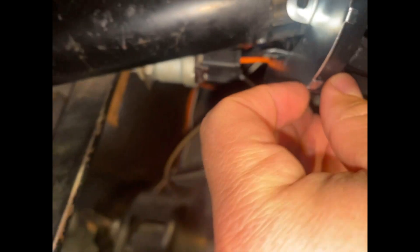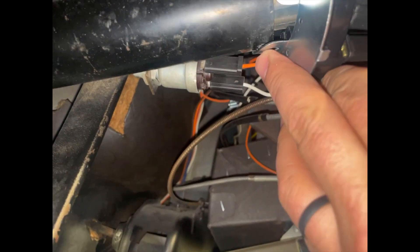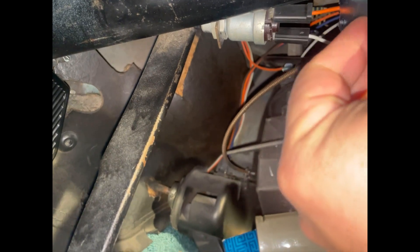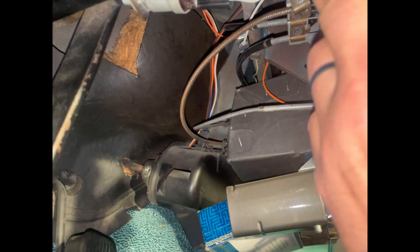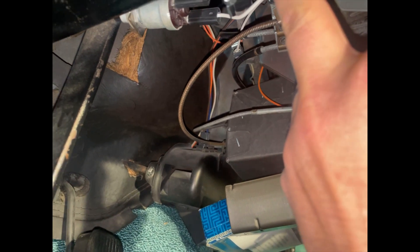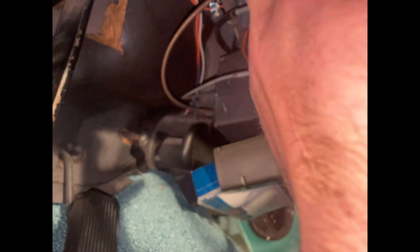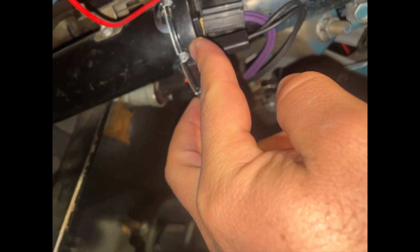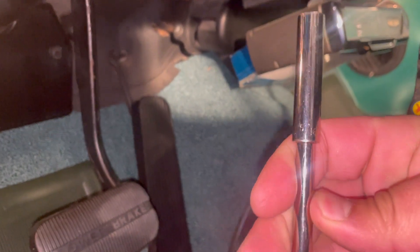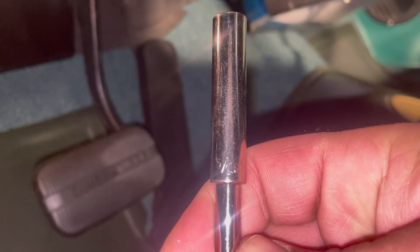It's important to get this slot onto that nub — just like this. You want to get it lined up, right there. Then you want to get a bolt started, and then try to start it and make sure it starts before you tighten it up. Then go through the gears — make sure it doesn't start in drive or reverse, just make sure it works as intended. Alright, got it started with one bolt. For mine, looks like they are five-sixteenths bolts.